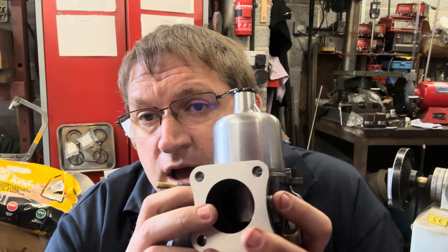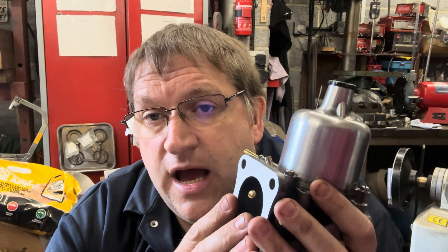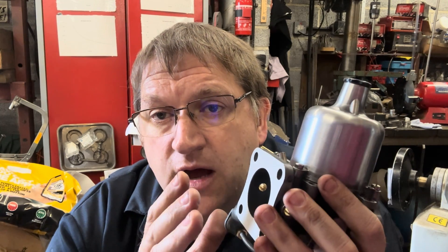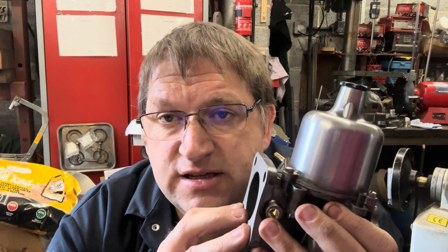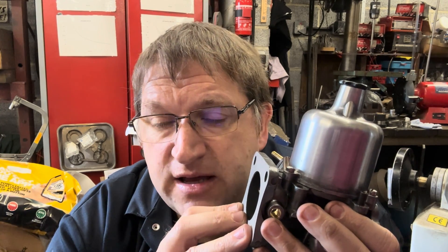Nothing to do with the cost per mile of fuel — clearly the one that's tuned properly and running efficiently will use a lot less fuel, so it'll save you there as well. But my point is the real expense comes in wasting a good engine by not having the fueling corrected. A lot of people set these up so they're too rich when they're cruising. The engine will perform well, but it wears quickly. Engine wear, piston ring and bore wear are directly proportional to the amount of fuel going into an engine. You only put the minimum fueling into an engine to guarantee maximum life. I'm talking about road cars here — race cars run 10 hours and the thing's rebuilt anyway, as long as it's got the right fueling for safety and maximum performance. But I'm not talking about racing. I'm talking about road, and that is a completely different requirement for carburation and longevity.